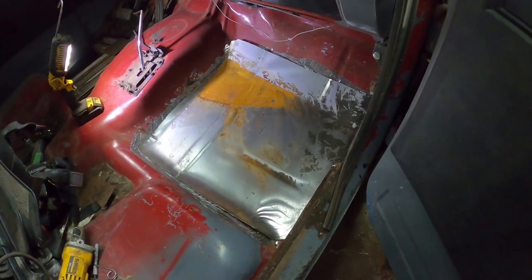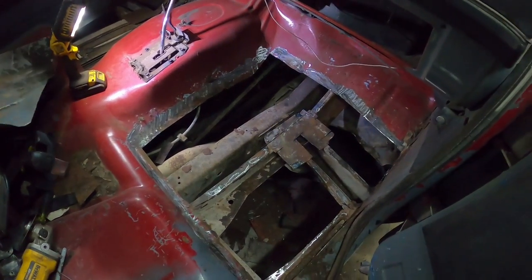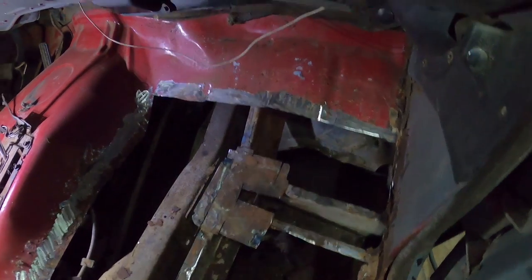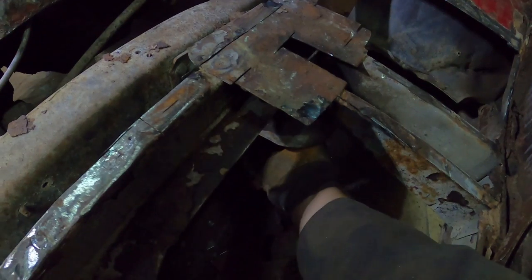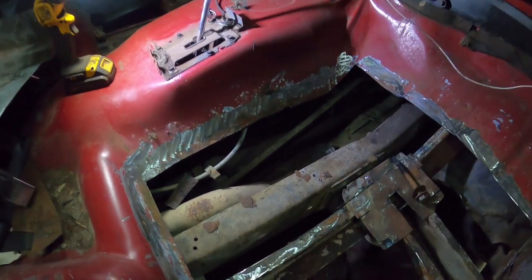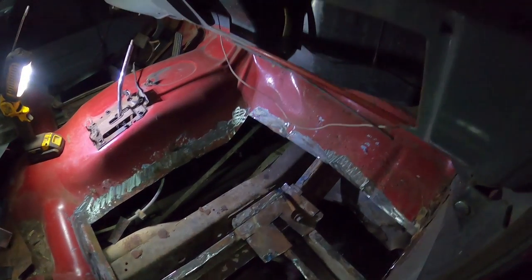Well, instead of stopping, I kept going. So this is actually the pan I had kind of butchered on that side - I cut it to fit. It's pretty good. I think I'm cutting out probably more on the floor than I really needed to. The reason was there was rough spots everywhere, and I had to cut this piece out because I needed to get to that body bolt. I'm pretty impressed with this, guys - look at that. Half wore out, still got it out. A little bit of heat and some penetrating oil, and you can get it out - don't just hammer it.